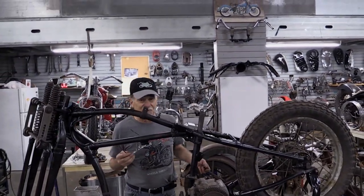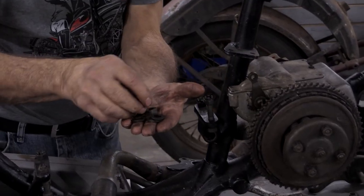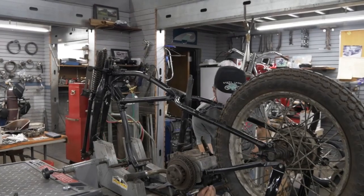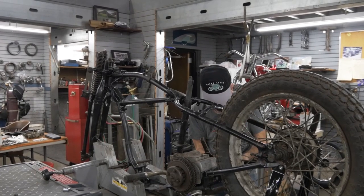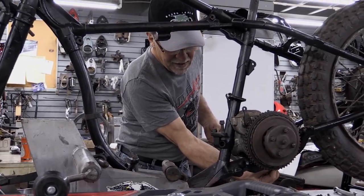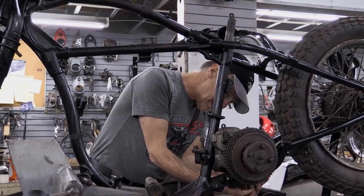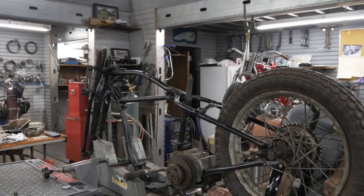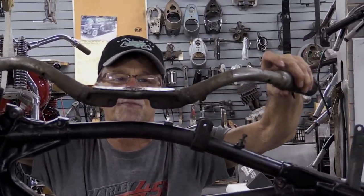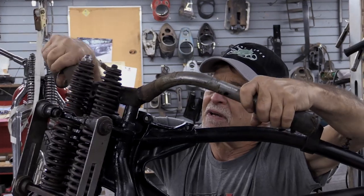What's really amazing about this motorcycle — Scooter said all the nuts and bolts are there and he was right. We've got all the original transmission, original nuts, bolts, and lock washers that go on like a champ. So I've got the transmission now well installed and the front end's installed. Time for the handlebars, then the front wheel. These are the real deal — these are WR flat track bars. Check out the bend; they're pretty straight. They've been welded and repaired, probably custom made, custom bent, just to the man's style.